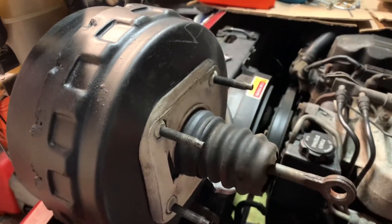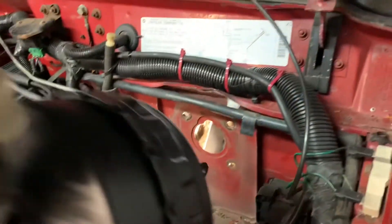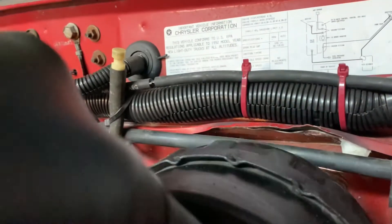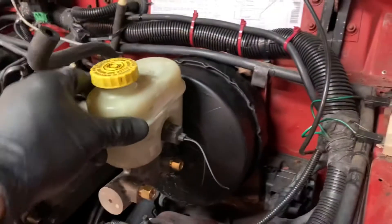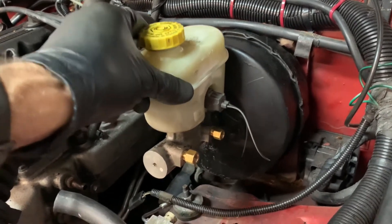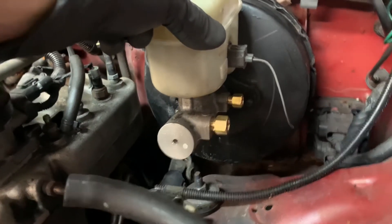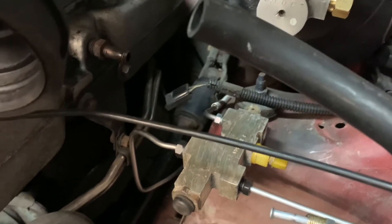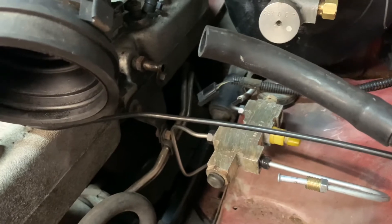Here are the four studs coming out of the power brake booster, and there's the rod that sticks through the firewall and attaches to the brake pedal. You'll have a little clearance at the firewall — I used a pair of vice grips, you can use a cutoff wheel, knife, fork, spoon, whatever you want. The lines coming out of the master cylinder are on the driver's side, whereas in stock format they're on the passenger side, and they loop right down to the proportioning valve.